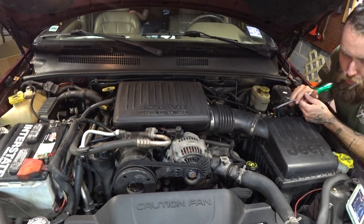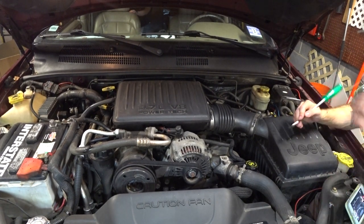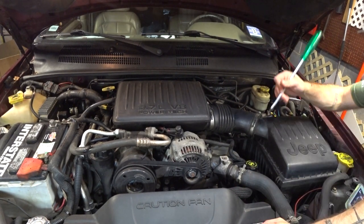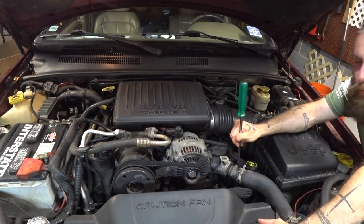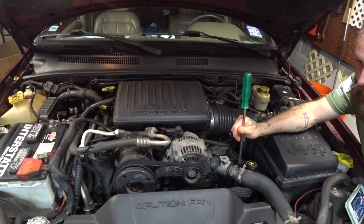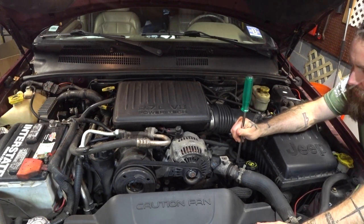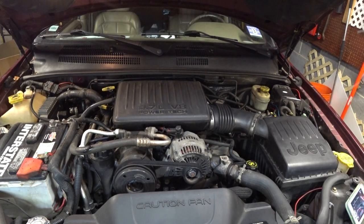I was one trip up the mountain, which there's a mountain in the middle of my town, so pretty much anywhere you go, you're going up the mountain, away from overheating this thing. So I got a new power steering pump, I put the right fluid in it, and you know what? It just doesn't work right. I've gone over the whole system. Every O-ring is new. Every line is new. There's a power steering cooler installed from the factory, and it just doesn't work right. And I believe it's one of the reasons that this dang old Jeep, she get hot.